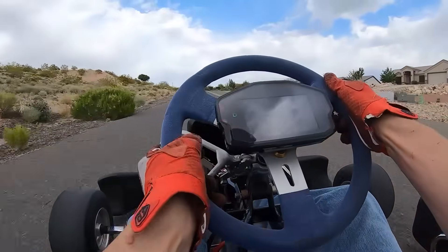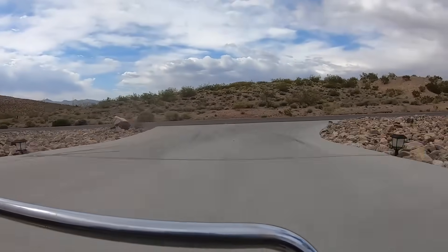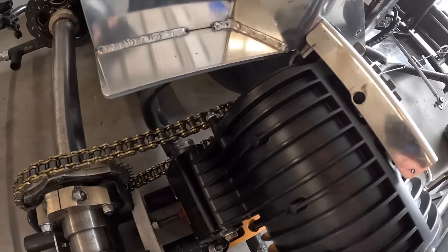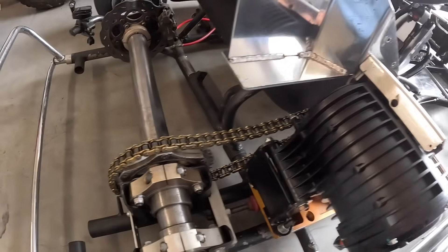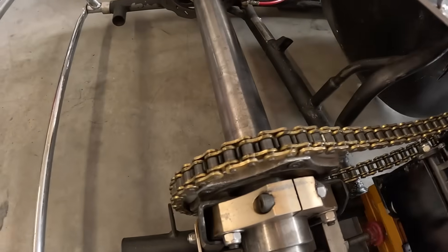Oh my god, this thing is wild. It has to be like the wildest ride I've ever been on. Instant torque — it's actually too much. I talked to Electro & Co and it is way over-geared. This kit is made for a full-size dirt bike, so with the gearing on here it's made for those tall tires. I have this 22 sprocket that I'm gonna throw on here — it's pretty much half the gear — and if that's not enough I have a 19 for the motor, going from a 15 to a 19.